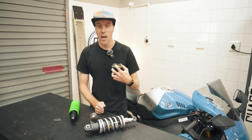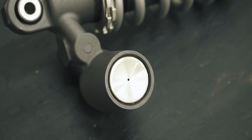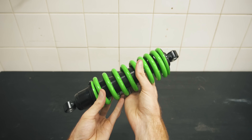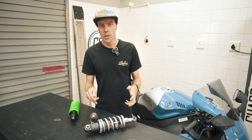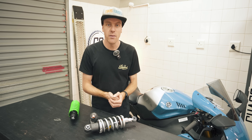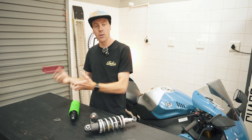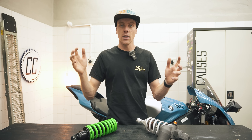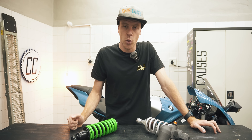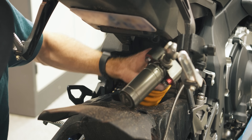Another very important difference is serviceability. If you look closely at the adjustable shock, you'll notice the spring can be removed, the oil can be drained, the clickers can be removed, and the whole thing can be disassembled. Whereas with the basic shock, the only thing that can be removed is the spring. So if the adjustable shock starts leaking, you can replace seals, refresh the oil every few years, or open it up to re-valve it. But if the basic shock starts leaking, you have to throw it away and buy a whole new one — there's not even a way to get the oil out without completely destroying it. This is why you'll only find adjustable shocks on sporty and premium bikes. They cost more to produce, but they offer a lot more benefits. And this is just the stock shock — aftermarket options take it to a whole new level, but I'll get into that in the next video.